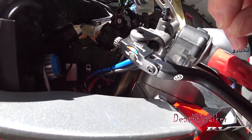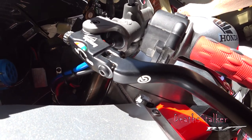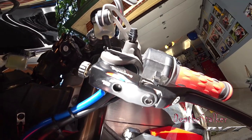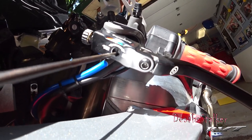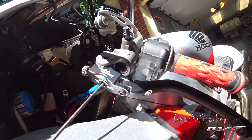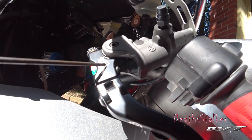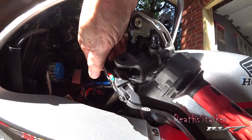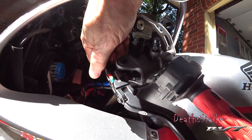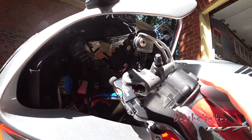Excuse the audio while I'm doing this outside. This rubber bung, which you just peel off with your finger, has a screw that you stick a flat-head screwdriver into. Now rotate it over and you can see it's black here — that's the higher pressure setting in the cam. I use the lower pressure setting for the clutch, and you can see that's shown here as red. You can adjust the lever about 16 clicks in increments.